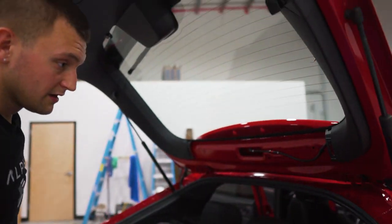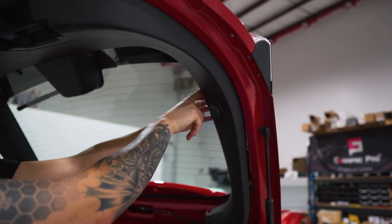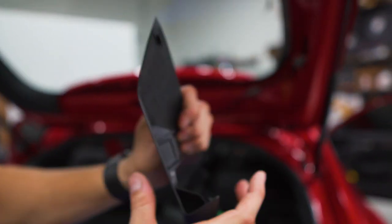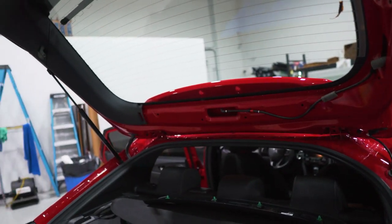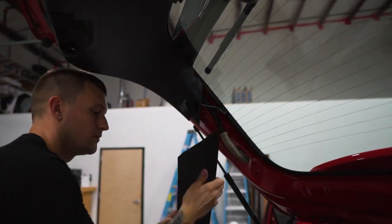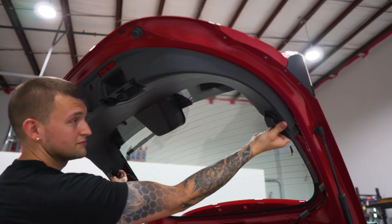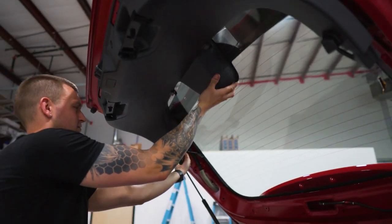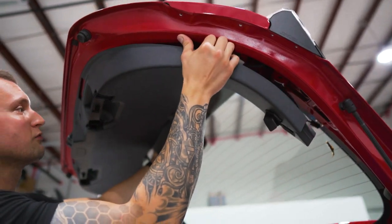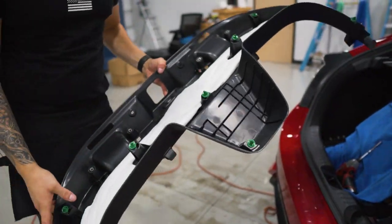Put that panel down. The sides simply pull away. On the bottom half section, you've got to kind of roll it away because it clips in at the top and the bottom — pull that clip out and it'll fall out of place. Same thing on the other side. Now take the whole top section, grab it on the corners, give it a little yank in the center, work it off, and it comes right down. It's just a bunch of clips — release those and put it to the side.